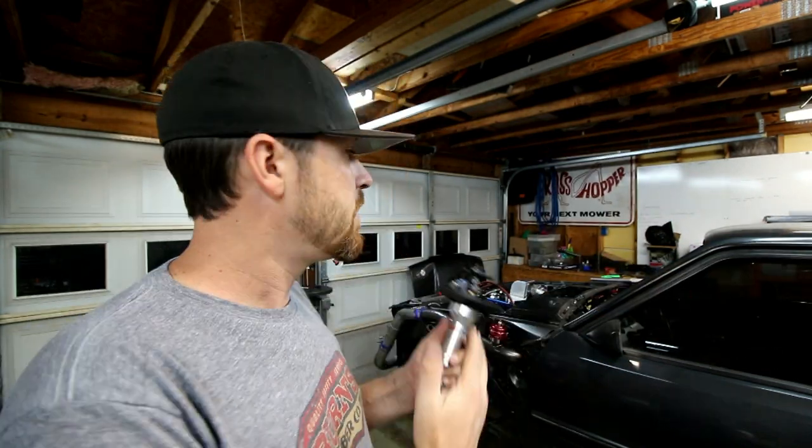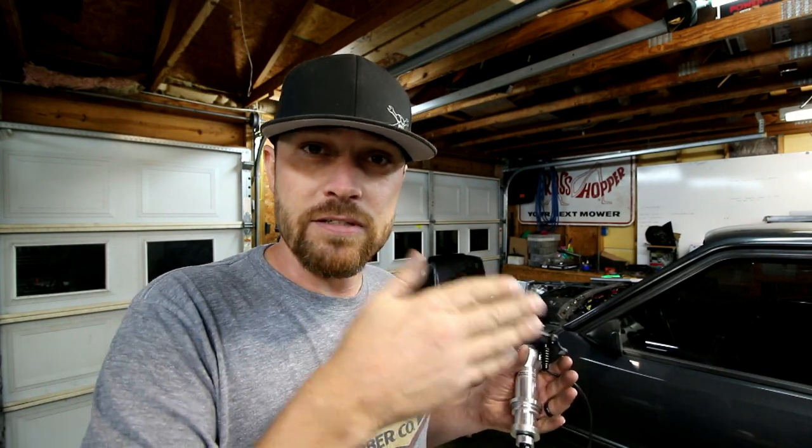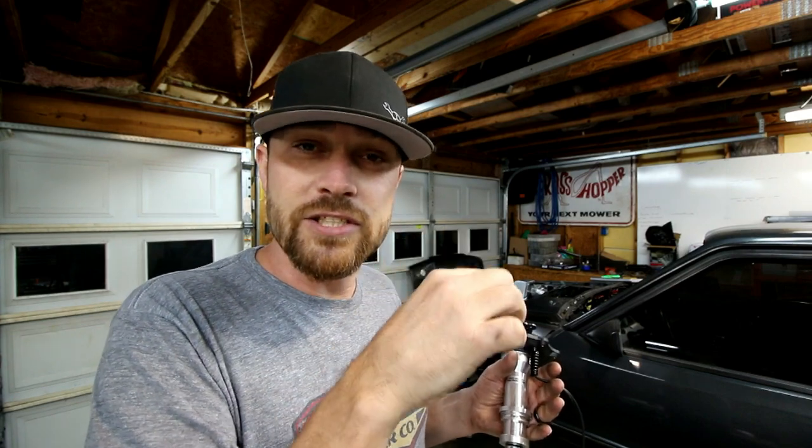Now, I had a lot of people comment when I was talking about doing this setup on this car. I had a lot of people say, why don't you just go with X box? It's easy. You don't have to do this, whatever. Well, the truth is, no matter what box you go with, if it does sequential tuning, meaning per cylinder, if you can change the timing individually per cylinder or change the injection individually per cylinder, you're going to have a cam sync. You're gonna have to do the same modification.